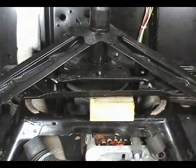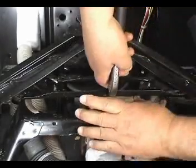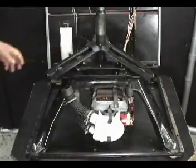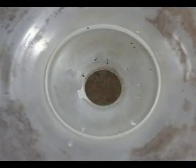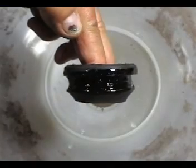Use the vice grip pliers again to lift the unit and remove the 2x4 blocks from under it. Then install the water shield on top of the motor. Take the new tub and place it on the floor upside down. I put some gasket shellac around the seal to make sure that the seal won't leak.